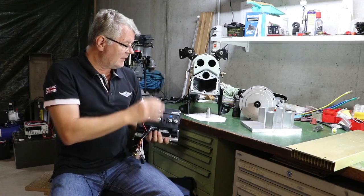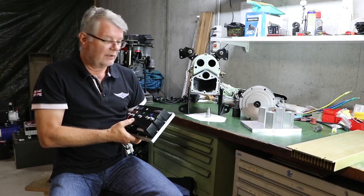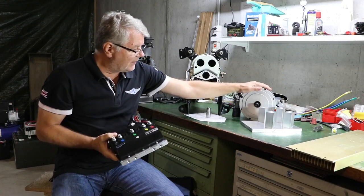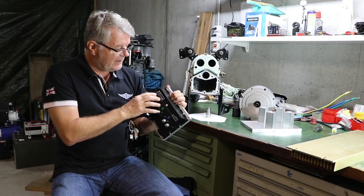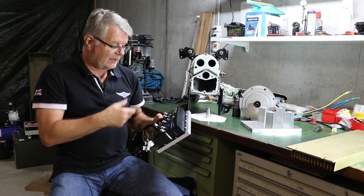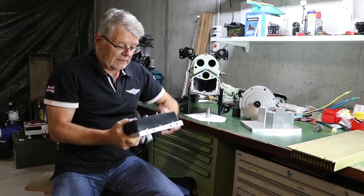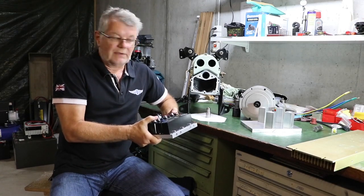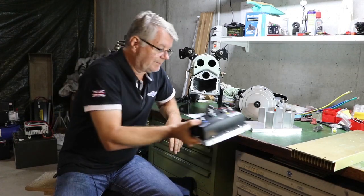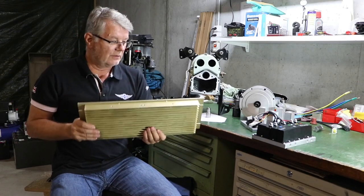The motor will run up to about four or five thousand RPMs, which is about the same as the fuel-based motor — so it's really an optimal choice. The three kilowatt motor is controlled by that controller, called EasyControl, and you have a phone application that connects via Bluetooth so you can adjust everything on the phone. The motor has an efficiency of about 85%, meaning 15% is turned into heat in the controller — about 300 watts — and I have an old heatsink that I'm going to use to cool the controller down.